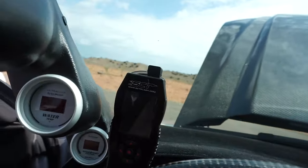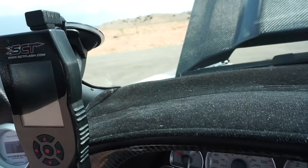I do have the trusty SCT tuner here with the windshield mount. I am planning on getting it tuned by VMP - that's coming soon, hopefully. I'm trying to get to the drag strip to see what it runs. I might do a run on spray, but it does go really rich on the spray so that's why I haven't been using it. It's going to get tuned for the meth, hopefully. I'm going to try to get one tune with meth and one without. The nice thing about meth injection is you can turn it off and on, but the boost juice is kind of pricey.